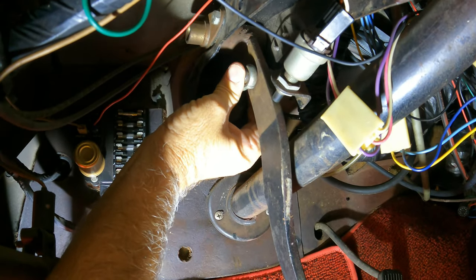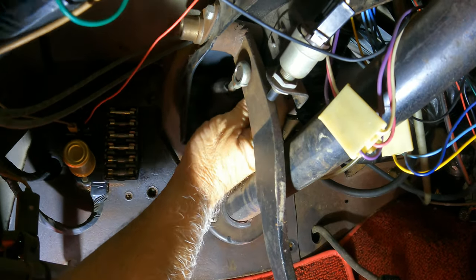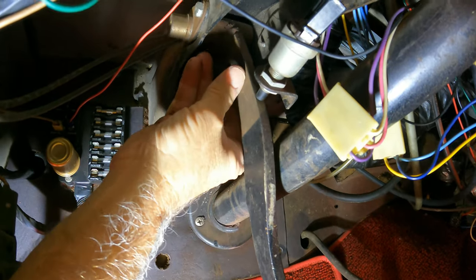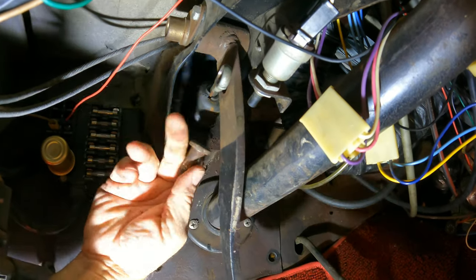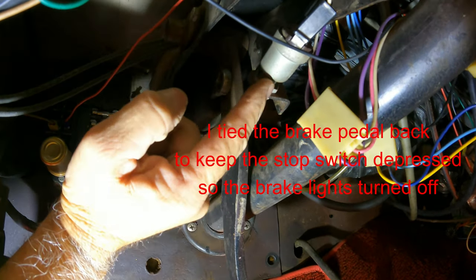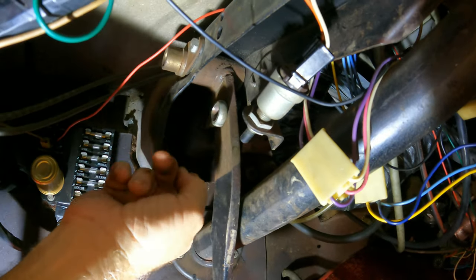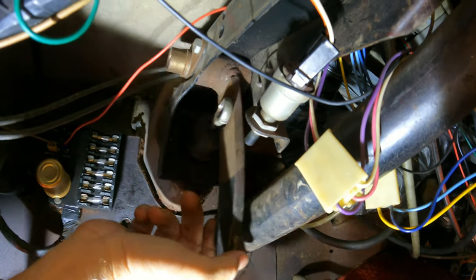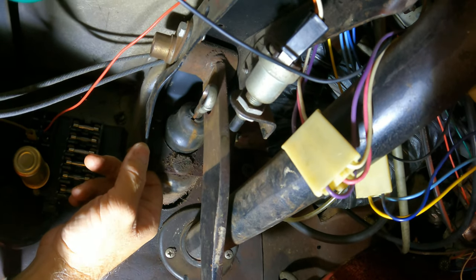This pin here slides out. If I can get my hand in there to get it out. When that pin comes out, it'll basically free that shaft up. There's the pin, and that pin holds the actuating rod to the pedal. We may have to pull this switch out later, but we'll cross that bridge when we get to it. Pull the cotter pin out, push that shaft out, and then this rod is free. This is on the back side of the master cylinder and the brake pedal is just kind of dangling freely. That's really pretty simple to get that part out of there.